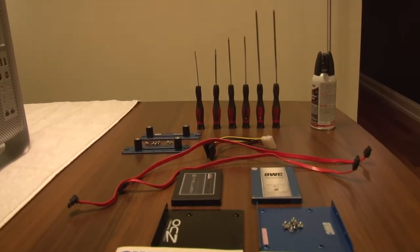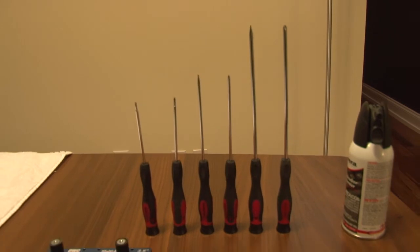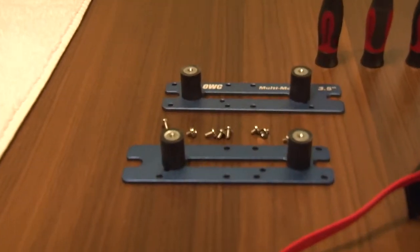One of the most important things is having the right tools. How many times have you stripped a screw using a screwdriver that was just not meant for electronics? Well, don't do it. Go to Radio Shack, go online, buy yourself a proper electronics toolkit. Most importantly for this job, you're going to need what is called a P-Zero — it's simply a Phillips head size zero, and that seems to be the standard size of the screws in most electronics.